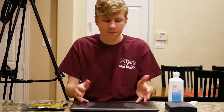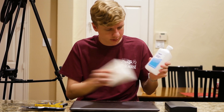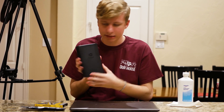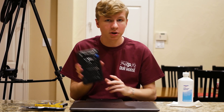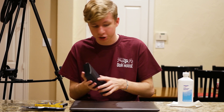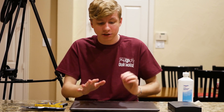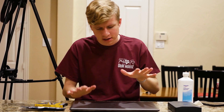First I need the laptop right here. I'm going to use isopropyl alcohol and a paper towel to wipe off the old thermal paste. I have the iFixit precision driver toolkit — it's not sponsored, I paid for this myself. It comes with a lot of stuff and I think I only paid like $25, pretty good deal. This is what I'm going to use to take apart the laptop. The last thing you need is another device — in this case my phone — that has the instructions.